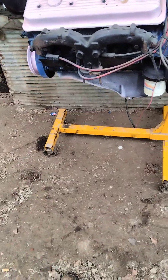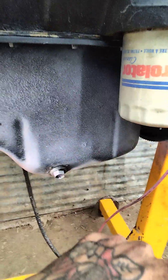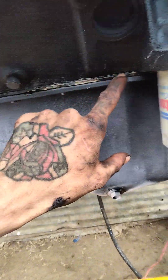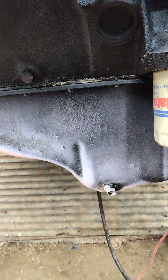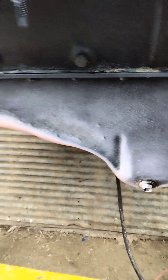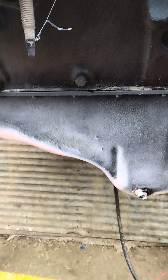This side will be pretty much done. Of course I still gotta get an oil filter, and I can see I need an oil pan gasket — it's leaking on this side, that side's fine but this side is. So I need an oil pan gasket — it ain't a big deal. And I still gotta make motor mounts because like I said they wouldn't work.